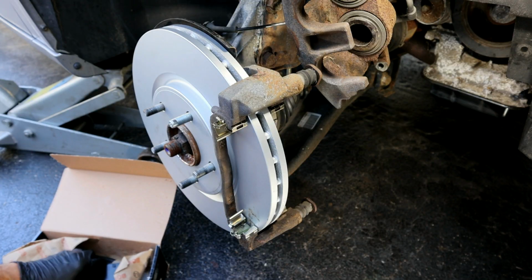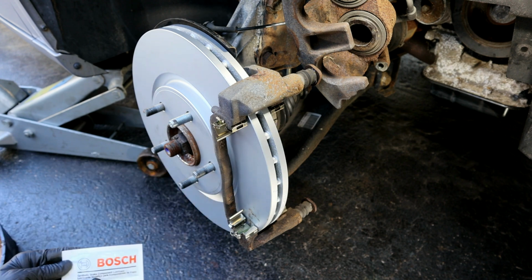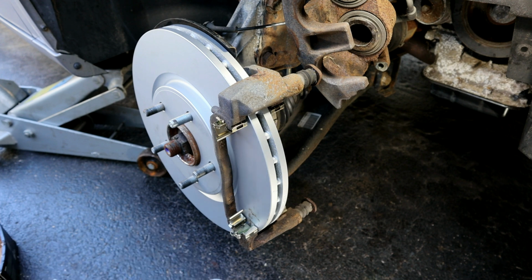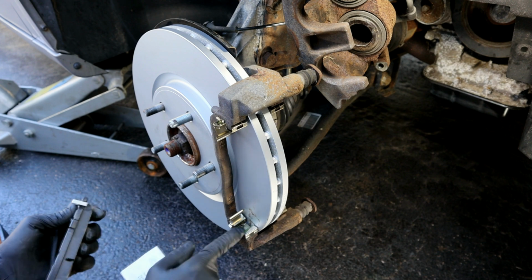Moving on to installing the pads. And it does look like this one did come with some brake lube, so we'll use it. But if it doesn't, you can also just use that same stuff you used on the actual slides there. And we're going to lubricate some of the ends here, then we'll go ahead and thread it in there on the bracket.